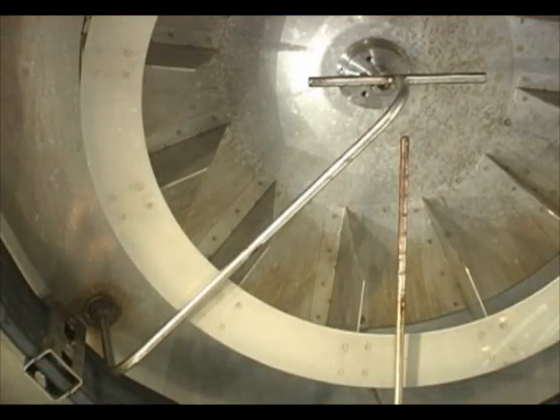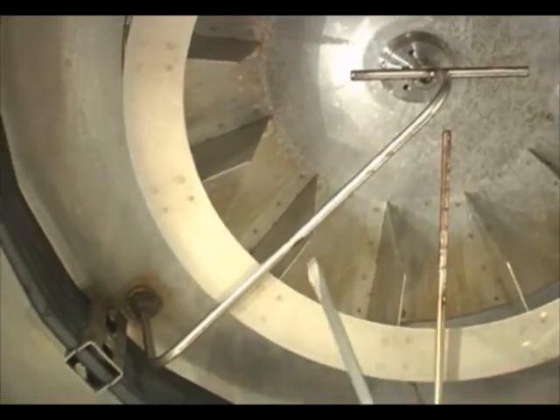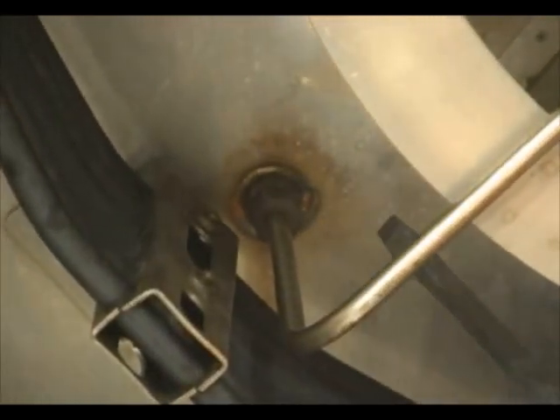It's as simple as cleaning the tubes and I'd like to show you how to do that. I have removed the wire grids and the air baffle and now you can clearly see the spritzer tube. Down here, right here, is the brass fitting.